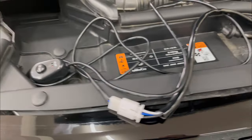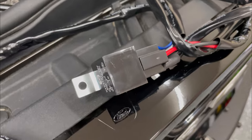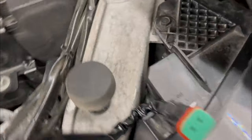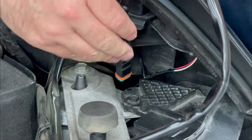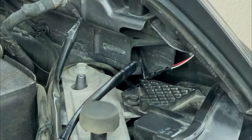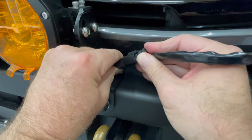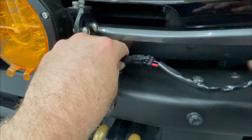Moving to the wiring harness — there's the switch, a good length of harness, the relay, the fuse, the battery connections, and the connector to join to the lights. Feed it down through this hole, and with the weight of the connector you can simply drop it down and pull it out through the bottom. You don't have to remove or unbolt anything — just reach up under the fender liner, pull out the connector, feed it up from behind between the bumper and the grille, connect it to the harness for the light bar, and tuck it out of the way behind the bumper.